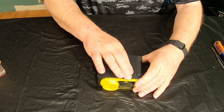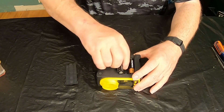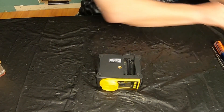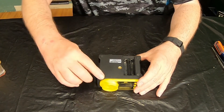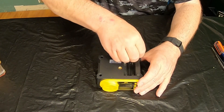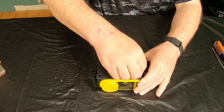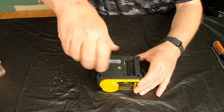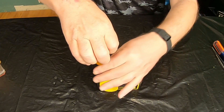The first thing we need to do is just turn it over, take the batteries out, and then you'll see there are four little rubber legs here. Those four rubber legs just pop right out. Inside each of these holes is a Phillips screw. Take your small Phillips screwdriver and just remove the screws — they come out really easily.